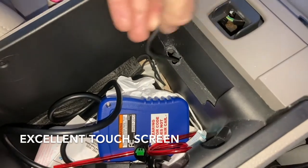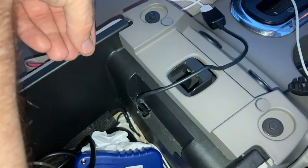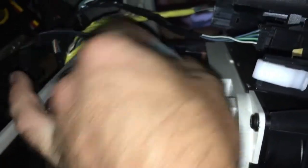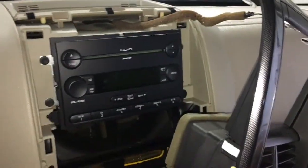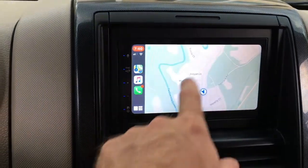It's a wired connection which I ran through the center console — I actually drilled a hole and ran the wire through it. It seemed like a much better idea than having a wire coming straight out of the dashboard. It's much cleaner and easier to use. The process for installing the head unit was really easy — you just pull the dash off. There are some screws exposed when you lift up the center console, then you take those out, pull that forward, which exposes more screws holding the stock head unit in. You pull that out and put your new one in.